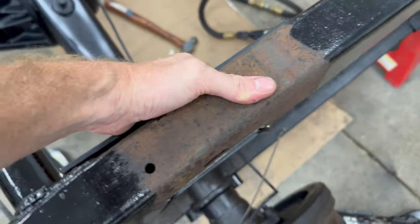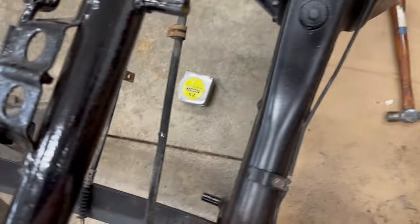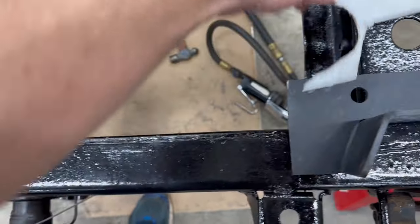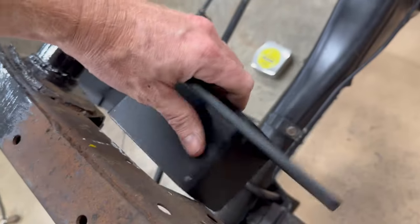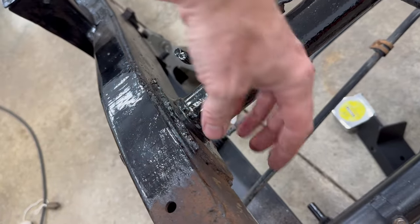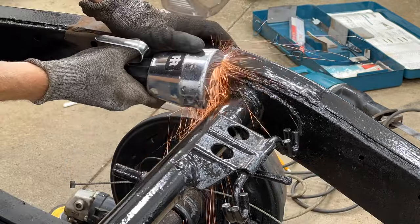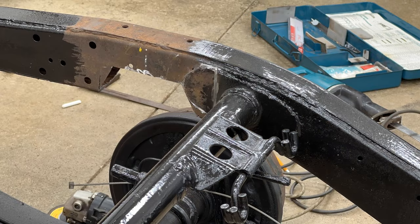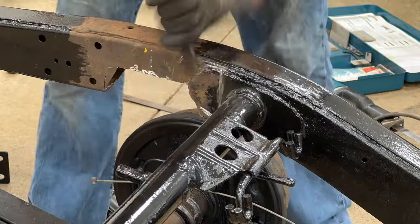My main concern is that the inside edge is not flush because of this factory bracing. So I have two options — I've made a template to go around this factory bracing and I can either cut this piece to fit flush around it, or what I think I'm going to do is draw a line straight down the edge so that it's flush with this piece and make a cut down. Then I'll have to grind down these welds and take this piece off, which will allow the edge of the mini notch to sit flush against the frame. Once I had most of the weld cut, I was able to break the rest with a hammer and chisel so I didn't risk cutting too deep into the frame.